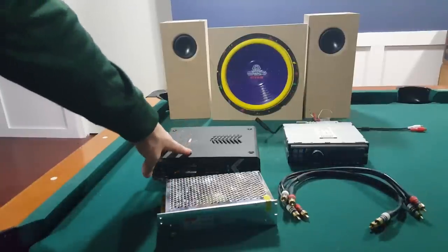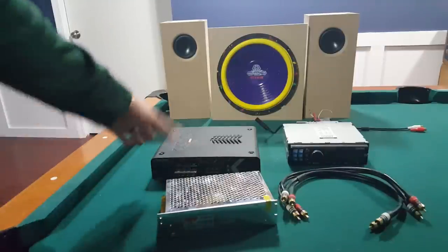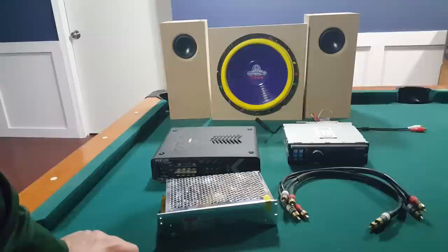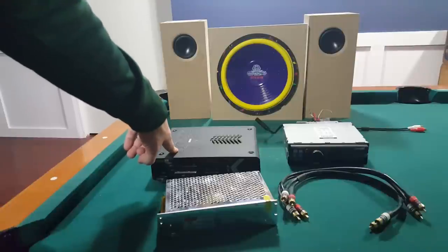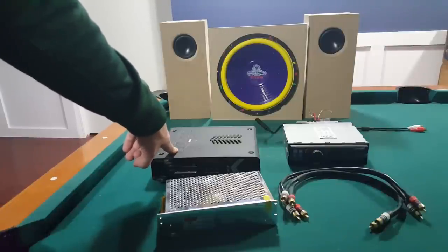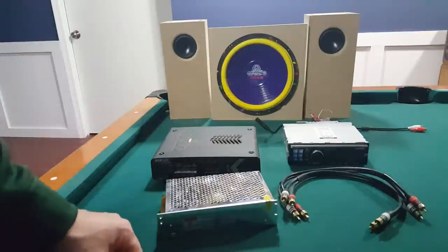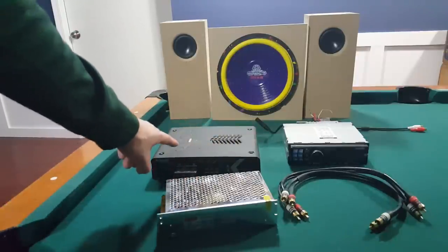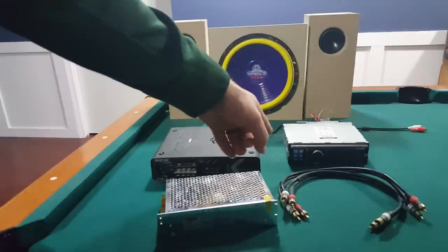You may look at car amplifiers and see something like '500-watt power amplifier,' but you're going to look at the 4-ohm or 8-ohm RMS rating — whatever impedance you're running your speakers at. This particular amplifier's RMS is 150 watts. Its peak might say 500, but RMS — which means continuous power — is only 150 watts. So you don't need anything bigger than that to run that particular unit.